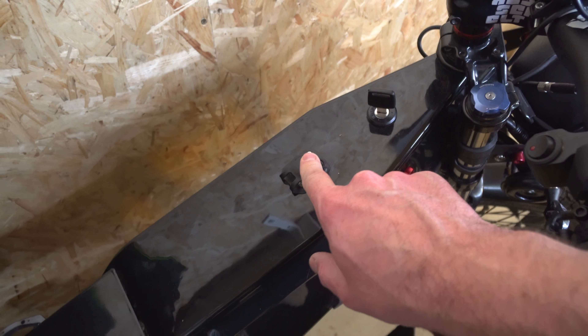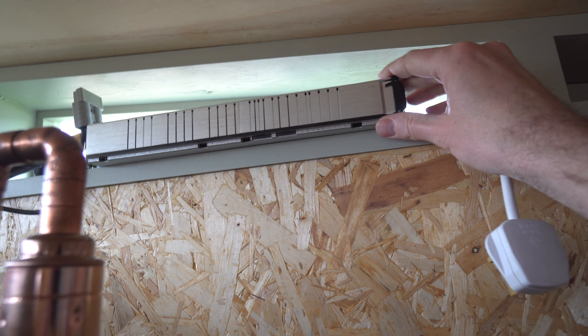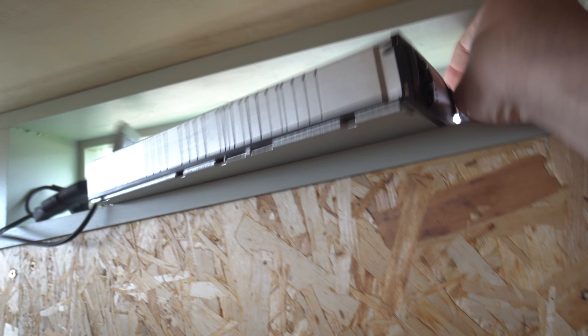The BMS also protects the battery — if one cell dips down too low it will tell you on screen whilst you're discharging, whereas a normal BMS may just cut out and you don't know what's going on. You can also fast charge through this port here, using a server power supply — it's like a 2 kilowatt charger, so it allows you to charge the e-bike as fast as the Twizy charges from its own built-in supply. Anyway guys, that's it for this one — it wasn't the most exciting e-bike video but it's showing you the genuine problems you have with e-bikes. I'll let you know how it goes — catch you in the next video.